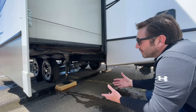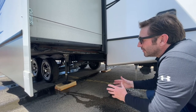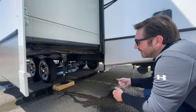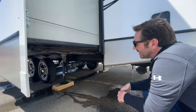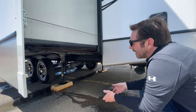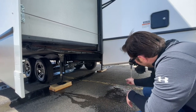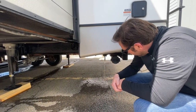When you're flushing out your black tank and your gray tank, you're going to want to pull your black first, and then pull your gray second. Make sure that they're closed when you're finished so that no gases come up through your sinks and your toilets. Here you can see the fresh water tank empty valve.